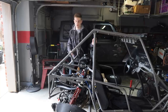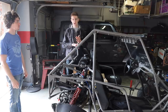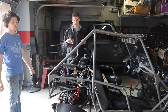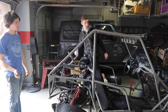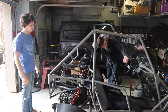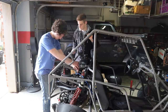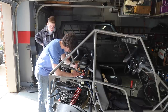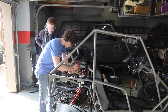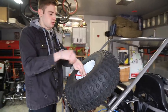With our valve lash being off and our carbs unsynced, there are a lot of symptoms, including fluttering at idle, hanging up at idle and searching. Hopefully, now that we have that done and we'll sync the carbs, we should be fixing pretty much everything. Let's see. All right, with that, the engine should be all done. This should be pretty much its final form, and we're ready to go drive it.